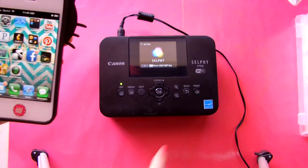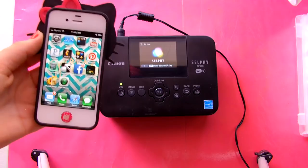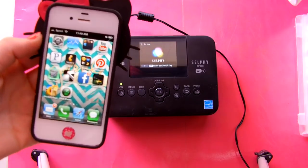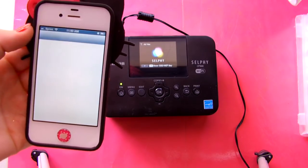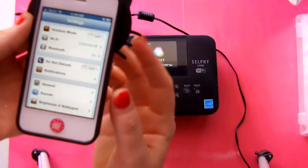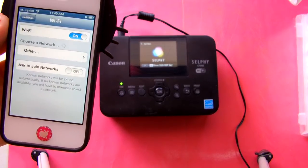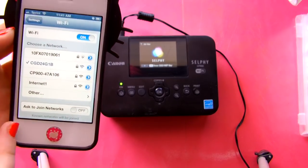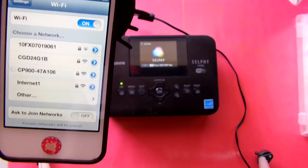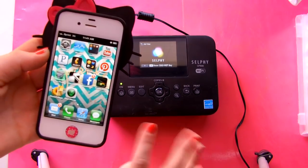The first thing you need to do — this has Wi-Fi and your phone should have Wi-Fi. This was the hardest part about learning how to use this printer, but once you get it figured out it's smooth sailing, I promise. You have to go into Settings and put the CP's Wi-Fi onto your phone — you have to connect them. By the way, this is the iPhone 4S. On the Wi-Fi list it says CP900, and that's the Wi-Fi I need to connect to. Once you see the check mark, the phone and the printer are connected.